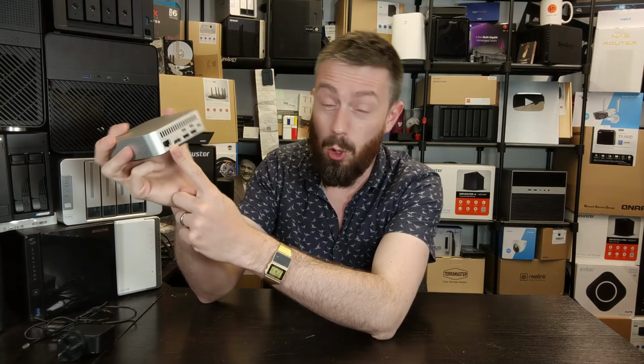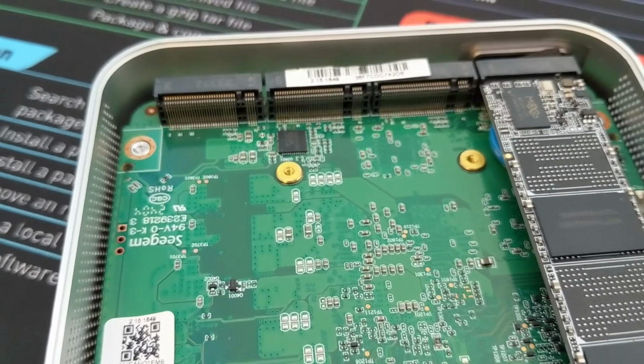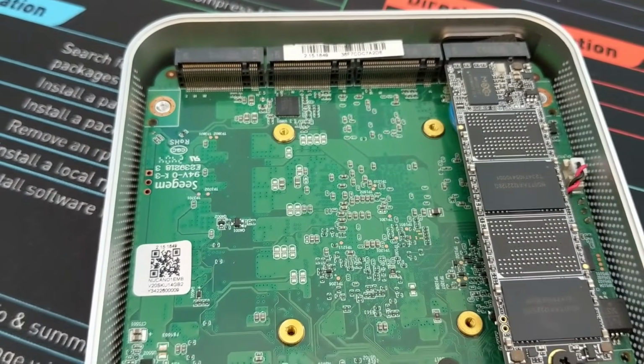This gives you a single 2.5 gigabit Ethernet port, so no failover, and also 2.5G, or around 250 to 279 megabytes per second, is not a lot. Indeed, I would say there are modern hard drives like the Seagate Ironwolf 24TB we talked about a while ago. That one hard drive on its own could fully saturate that connection. And this thing has got 4 M2 NVMe slots inside. That is one of those hang-ups from mini PCs I do not want to see here.